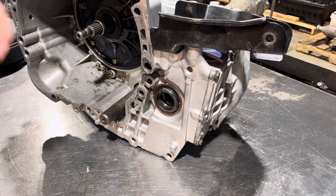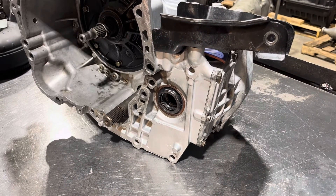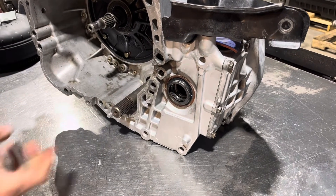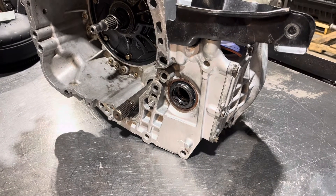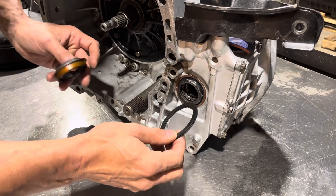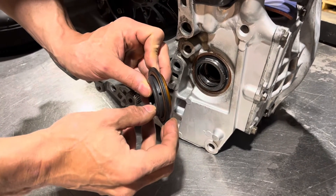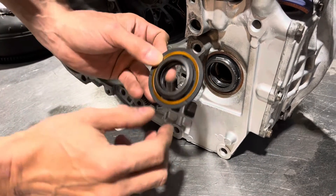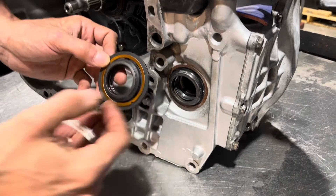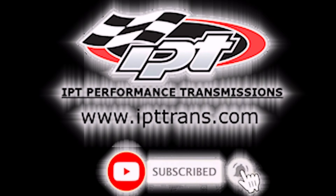A lot of you guys are using a 2G trans with your six-bolt engine with the Kigley kit, which spaces everything further away. What happens is sometimes the axle stub shaft kind of comes off the seal where it's supposed to be sealing because you've moved it out a little bit, and it's going to leak on you. What we do in that situation — I made this out of some existing parts — it's basically two washers and a seal. This is approximately the thickness of the Kigley kit. We put the seal in, drive it in, and that's going to position it on the axle stub shaft so it's not going to leak on you. Please like, share, subscribe, and hit the notification bell.